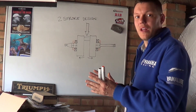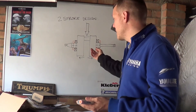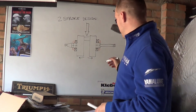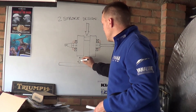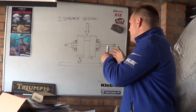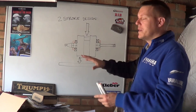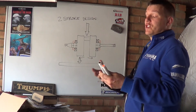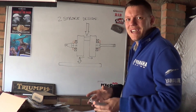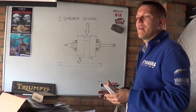And you'd have a lot more wear, a lot more strain and stress on the actual cases, and the crankshaft is more likely to start to bow out. One of the problems with crankshaft design — be it a two-stroke unit crankshaft like this or a four-stroke — is that the loading always happens at the same place. With reciprocating engines it's always at top dead centre, up to about 45 degrees — that's generally the area. The crankshaft will always be in the same location because of timing. So you're always going to have this loading on your crank pin and on your bearings in exactly the same way. If you space out your bearings, this loading is going to be more severe, there'll be more crank deflection, and things will wear out quicker.